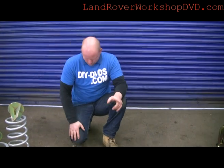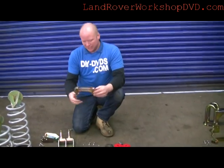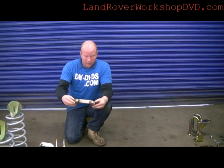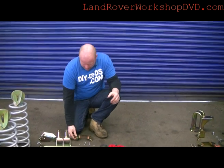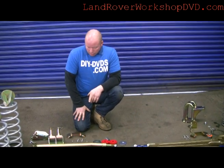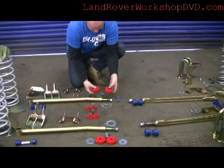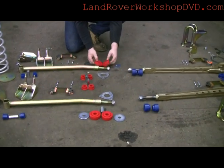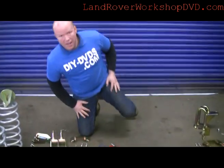Don't forget to watch the whole thing before you go ahead and do yours. Bump stop spacers — nice simple bit of kit, self-explanatory. Lift the car up two inches, put the bump stop down two inches so your shocks won't bottom out. Rear radius arm front end bushes — different colours for different grades from Polybush. The man from Polybush told us what we were going to do and sent us down the right colour for the job. I'll explain what he explained to me as we go.